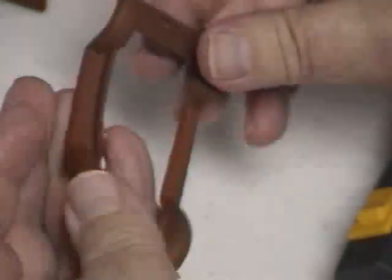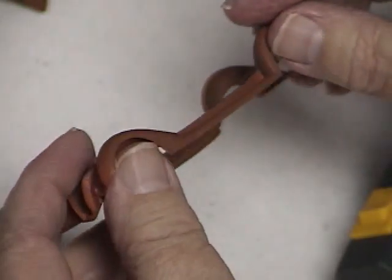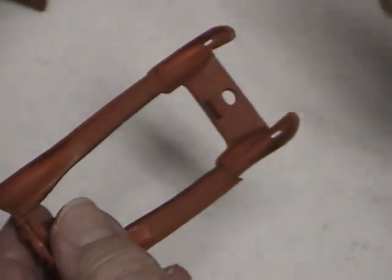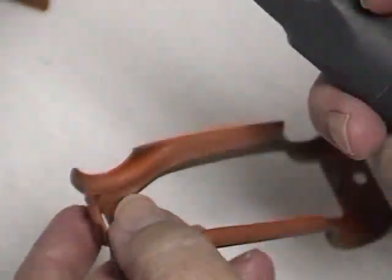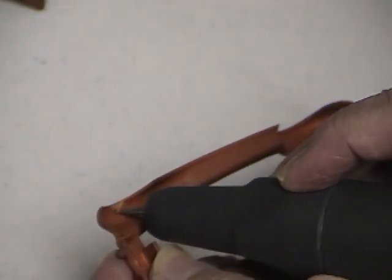Now here I have a little grinding device — I've got several different Dremel tools, and this one is actually an engraving device, a very small unit, with my smallest bit in it. What I want to do is reach up inside this fender well and grind it. You can see how tiny that little bit is. I'm trying to make that fender, working from the inside, almost as thin as paper — just absolutely as thin as I can get it. I'm showing this in actual time so you can see how much time I actually invest working on the inside of this fender.